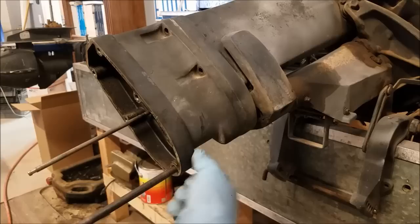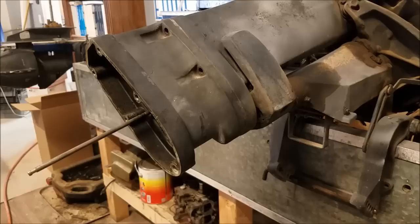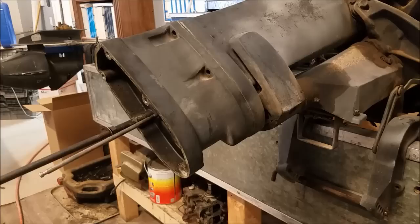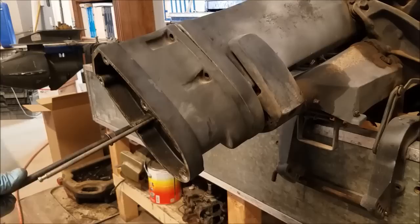I'm going to need a smaller slide hammer — definitely going to need a smaller slide hammer. That sucks because it's the smallest one I've got. Alright, I have a thread adapter to adapt the slide hammer down a little bit. I'll try to remember to put links for the parts and tools that I use. So I'm threading it into the housing there, kind of hitting it, which broke that seal loose, but it's still tight up here.